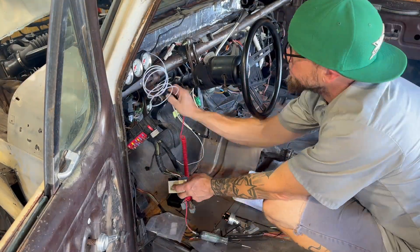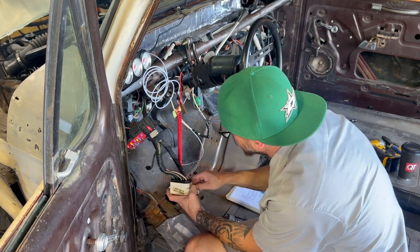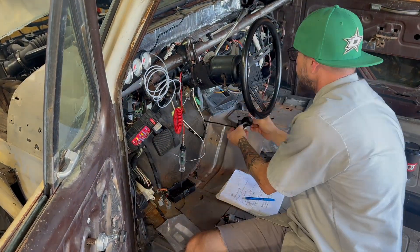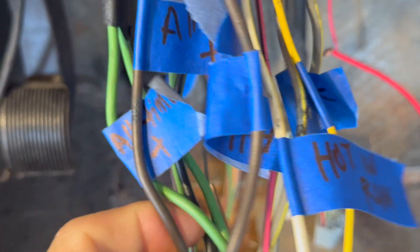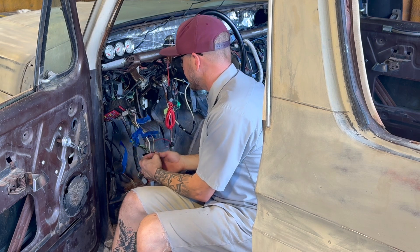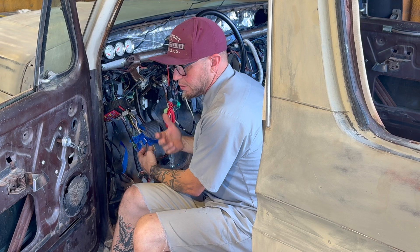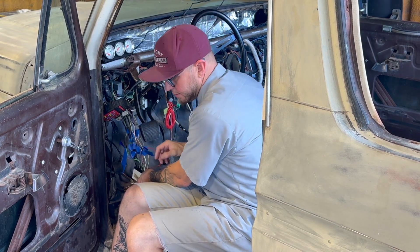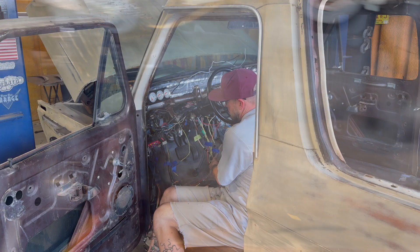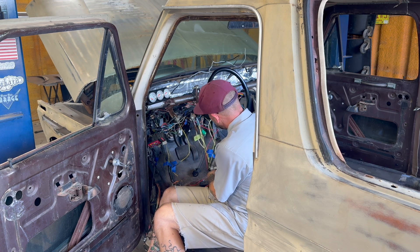So we know everything works. Everything in the wiring harness to the ignition switch is labeled. I've got the labels on each wire that's hot when the key's on and in run, and then the wires that are only hot during the start circuit. I've got the wires labeled that go to the ignition to start. It's really not as complicated as it looks. The gray wires with the yellow stripe are typically the O2 sensors - that's just the heating process, that's why they're so big. They actually have their own relay. I'm going to cut these, wire into the ignition switch, and see if this thing will start still. I've got the security key pinned in there.